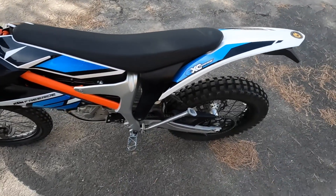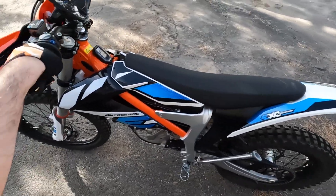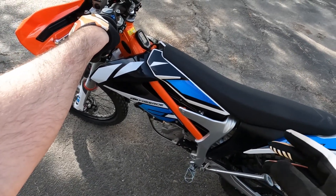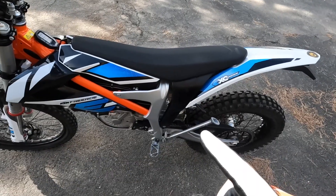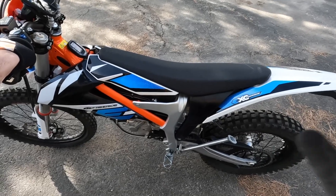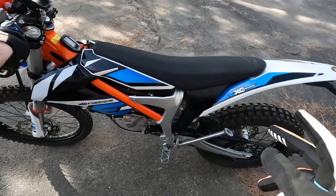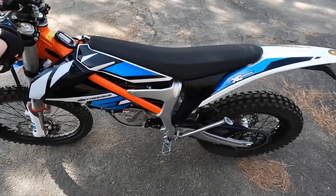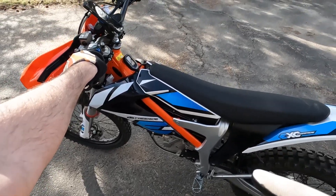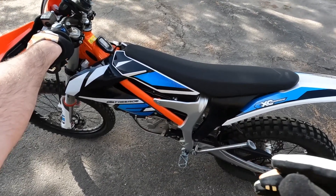Let's do some acceleration tests on the KTM Freeride. This bike is very heavy — it weighs more than pretty much all our motocross bikes, right around 250 pounds. It's got an 18 kilowatt motor. The Sur-Ron and Talaria are 6 kilowatts, so this is three times the power of a Sur-Ron. When we crank up the power on our modified Sur-Rons we're running a 15 kilowatt tune, but we hardly ever run it because it's just too much power for such a lightweight bike.